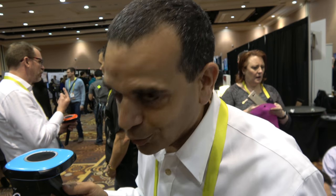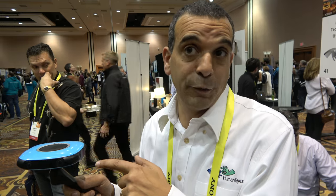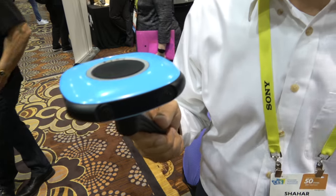What's the bitrate? Well, the bitrate is 120 megabits. So it's a pretty big bitrate. Yes. It's about 1 gigabyte of raw data for the camera itself. So if you have a 64 gigabyte card in the camera, it lasts for 1 hour, but the stitched output file is about 300-something megabytes per minute. Per minute.